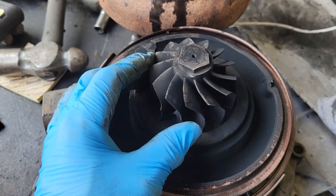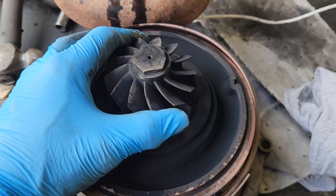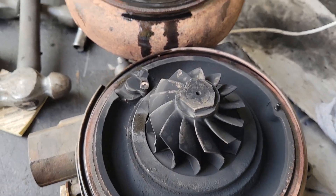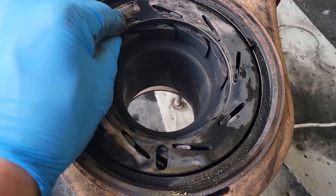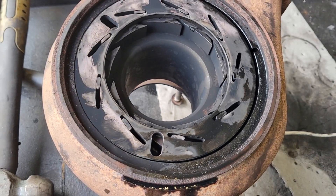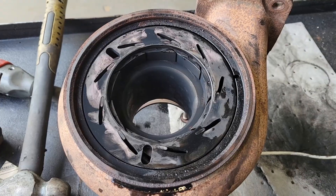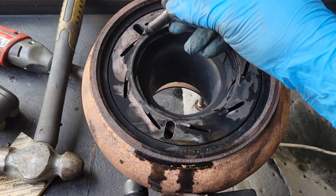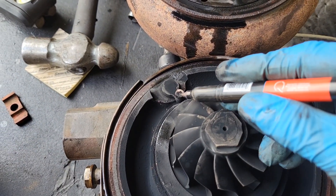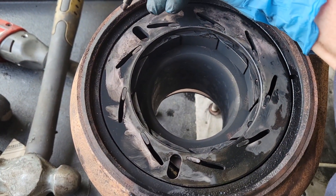So if you take yours apart, check the turbine wheel — you don't see any damage, no oil leakage, no play or anything like that. And your problem is these vanes hanging up. Provided there's no damage or excessive wear, you can take it apart and clean it. Before you pull this apart, make sure these line up when you go to put it back together again, so you can never go wrong with making some marks.